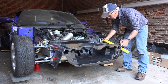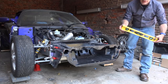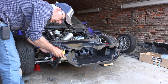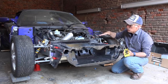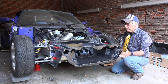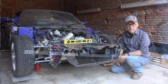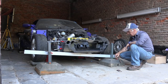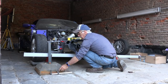Use any ruler to measure the distance from the edges to the aluminum chassis — in my case it's exactly 19 on both sides, so I know the distance from the chassis to the front is the same on both sides, and it's horizontally perfectly level. Since the car is level both vertically and horizontally, I don't need to worry about tilt. Now we need to put a supporting fixture underneath — I'm using metal bars in a heavy block and an aluminum bar to support the crash box from below.